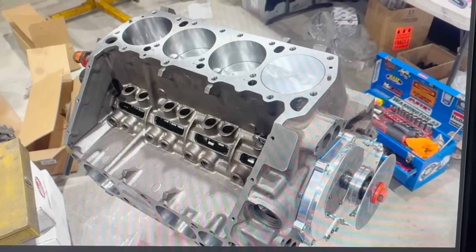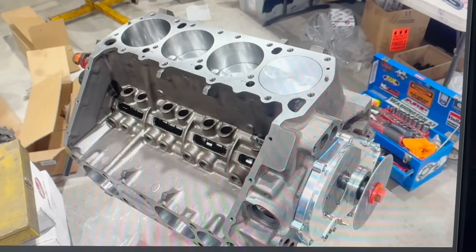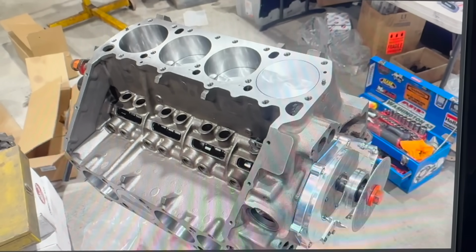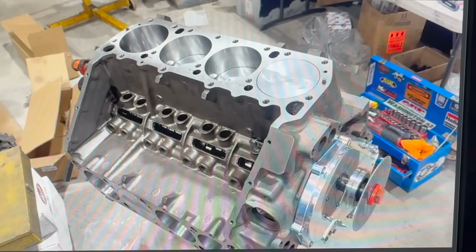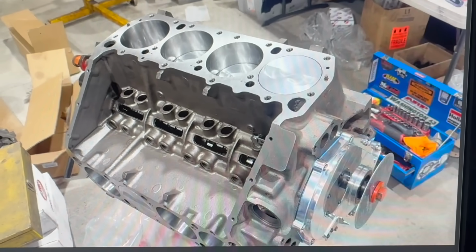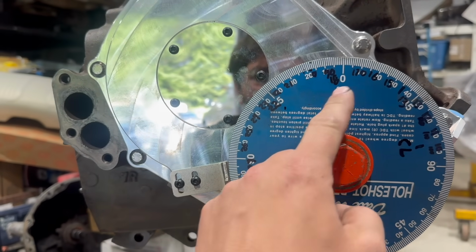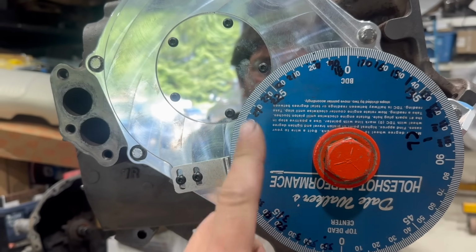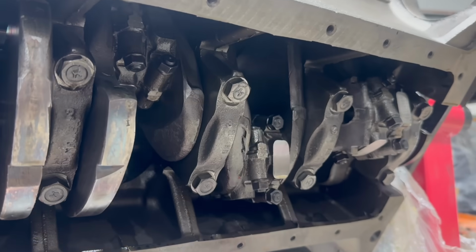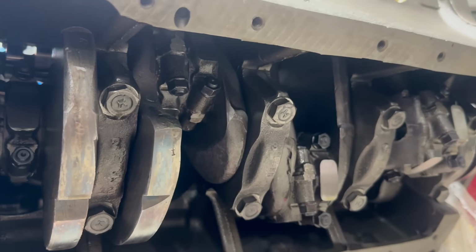Valve timing events are obviously controlled by our camshaft grind. The important thing we need to know is the closing point of the intake valve to make this calculation. And that closing point is controlled by the duration of our camshaft lobe. So we're going to make a measurement here to figure out where that valve closes. I've carefully, repeatably found a measurement here, which is 104 degrees after bottom dead center. That is the number we need to plug into a calculator and find our dynamic ratio. The other number we need is rod length, which is 6.76 inches in a stock 440 like this one.